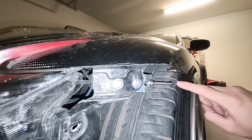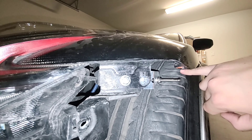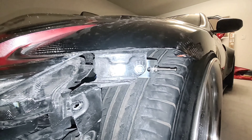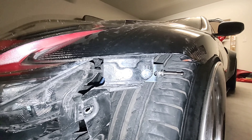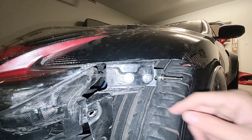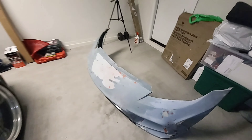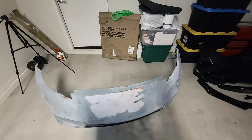The reason I did this quick release setup is twofold. First, the plastic clip piece that normally attaches the bumper — I actually lost mine. Second, my fender and bumper are really close to the tire, so it's most likely going to hit and crack it; this way I can prevent that issue. I purchased the hardware from Home Depot — just two bolts, two locking nuts, and a metal piece I cut with a grinder and bent at a slight angle. Then I use my OEM plastic clips to finish the install.